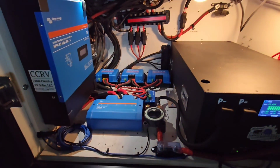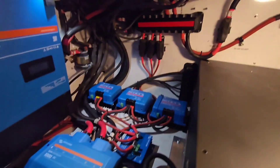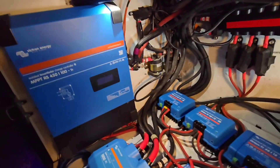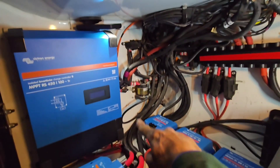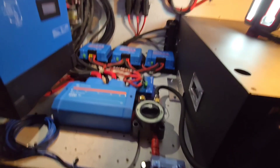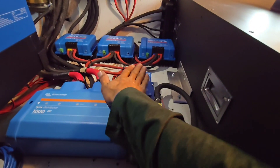This is when I got done — it's dark out, surprise surprise. I changed up basically everything that was on the floor. I ended up adding two more 48-to-12 DC-to-DC converters, so now they've got 90 amps of available power, which is enough to run their big slide outs and their hydraulic jacks. That wire that was incorrectly combining the two systems together is no longer there.